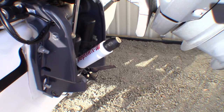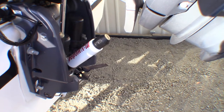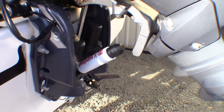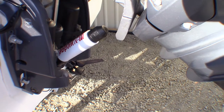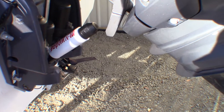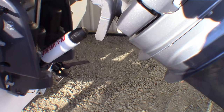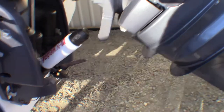To be honest I'm not sure what I think about the MyWedge at the moment. This transom saver is shorter — it lets the engine tilt down further than I'm used to, which puts the bottom of the engine closer to the road. I don't think it's too close to the road, but tilting it down further does lower the center of gravity on the motor and puts it back a little bit further away from the transom. All that's going to combine with more strain on the transom.